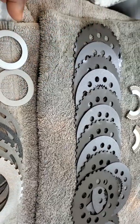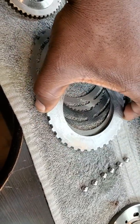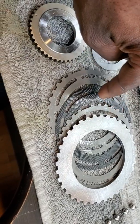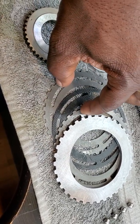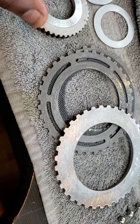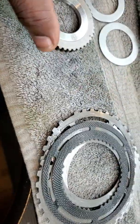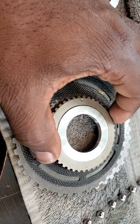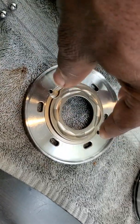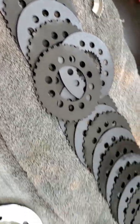This coupler essentially operates based on the electromagnet energizing this ramp pressure plate, lifting the entire ramp assembly up, sandwiching this rubberized-coated clutch in between these two ramp pressure plates. They are really thin — less than a millimeter. Their whole idea is to sandwich this clutch together, which in turn will force this cam to lift off of these ball bearings, off of this ramp assembly, applying downward force to sandwich these clutches together and send power through them. That is how your entire system works.